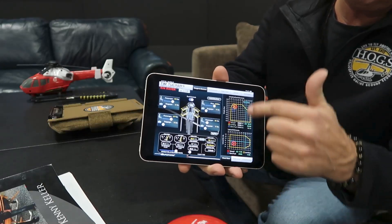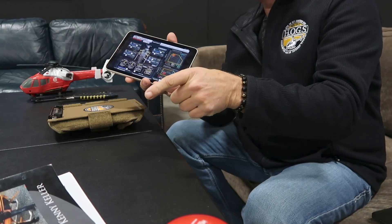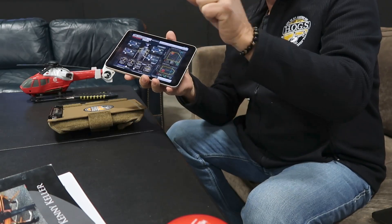If you're not taking the time to make sure you're within weight and balance, within the center of gravity limits, you could get yourself killed. The reason that we push weight and balance is because the aircraft may take off just fine, may fly just fine, and you won't notice anything. The problem is if you're overweight or out of the CG limits and you have an emergency, you may not be able to deal with that emergency and end up in a fatal accident because you couldn't recover properly — because you're out of CG or over your total gross weight.